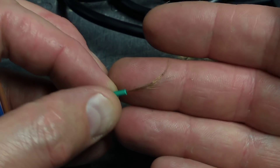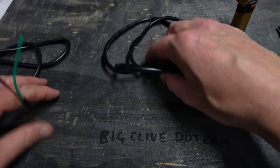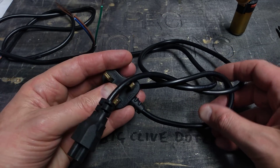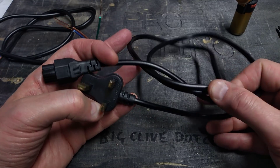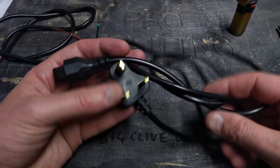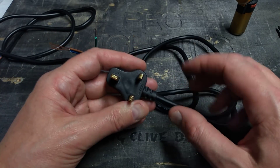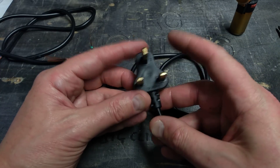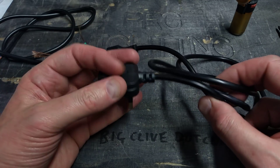This is ultimately going to cause so many problems in the future because you're getting a lead that you'd think is usable for many applications. This claims to be rated at about 10 amps, but in reality if you loaded this up to 10 amps there's a very good chance this cable may actually start smoking and cause problems — it would certainly suffer thermal damage. So keep an eye out for these when you get appliances from China, because that's where a lot of this stuff comes from that bypasses our regulations. If you're in the UK and you get a plug that looks like this, just bin the whole lead. That's the best bet — replace it with a proper lead.